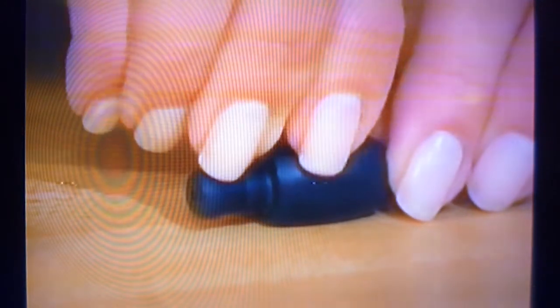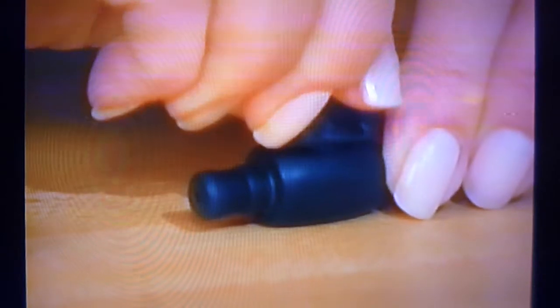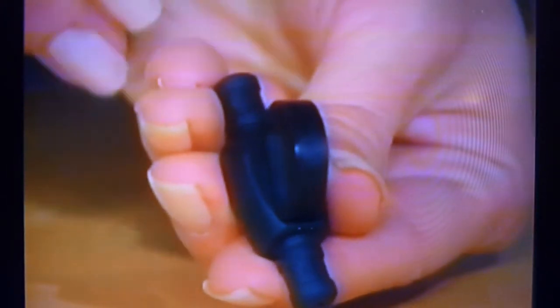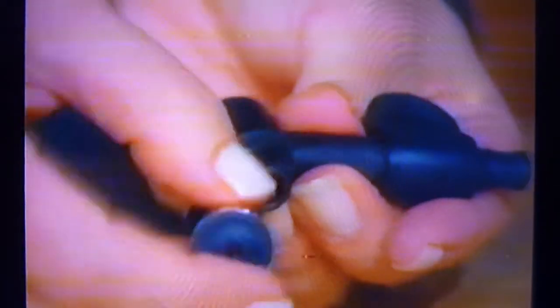Now assemble the frothXpress parts as shown, making sure all parts are put together tightly. Pay special attention to the knob, making sure it snaps securely into place. The knob should sit parallel to the assembly like so. If it sits perpendicular, no milk will come through. This assembly is explained in the instruction book and the helpful hint card, which comes with the machine.